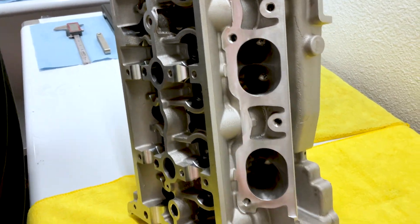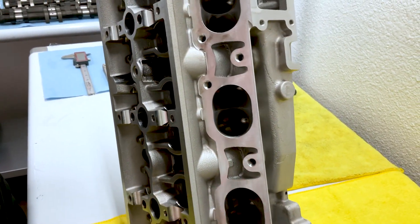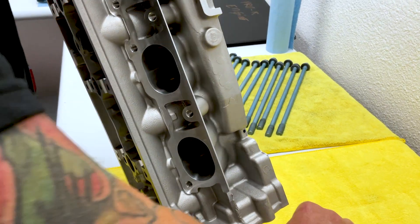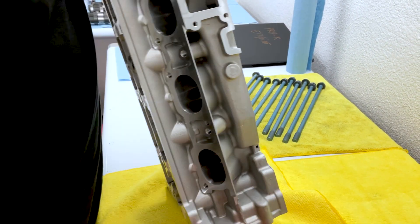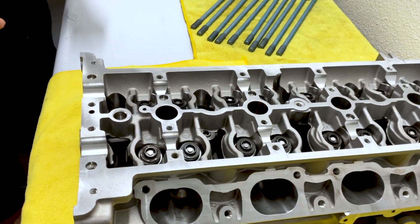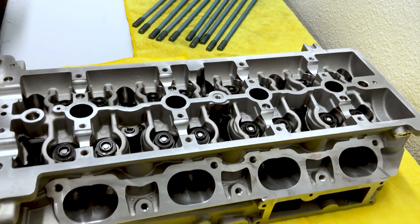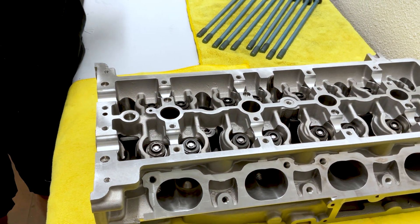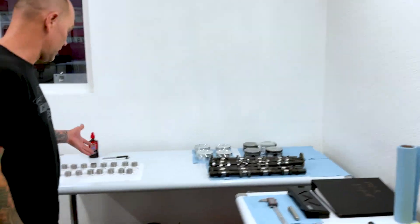Here's the intake side. You might be able to see some ink marks on those valves — that's actually a lot of footnotes that we put in when we're putting these engines together. We actually weigh the valves, weigh the springs, and test the springs to make sure every intake valve is literally the same within a hundredth of a gram. The intake on this engine — every valve spring is running 145 pounds at its full max compressed rate with the cam we're running, and every single valve and valve spring assembly with the bucket — here's a chart right here, you can see the buckets are all laid out.